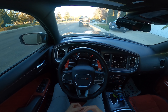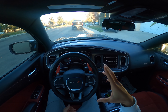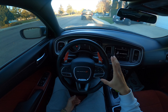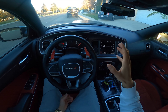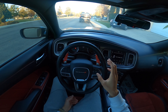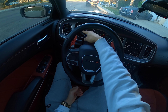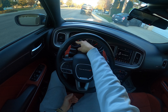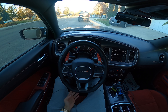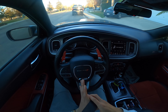It's just something we got to deal with as Hemi owners. We're gonna warm it up like this for a little while, keep it between 1500 and 2000 — don't go above 2000 because you don't want to rev it too high, especially when you just start it. So we're just keeping it between 1500 and 2000. When we first started it was probably about 1250 RPMs. We do this for a little while and then we let off, and you see we're good to go — it's below 1000. The RPMs dropped — that's how you know it's warm enough.